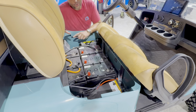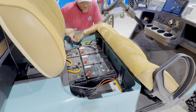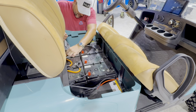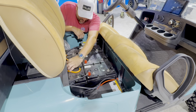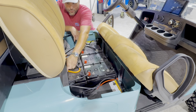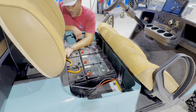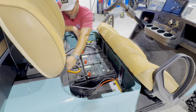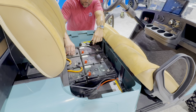We hit a little snag. There's a rear cover here that covers the golf cart's rear body and the battery is tucked way back in there. So we're going to take a little detour with a 13-millimeter wrench. Loosen the nuts on the top of the batteries very carefully — be careful not to touch your wrench to another terminal. Put the wrench on the nut, loosen it a turn or two, and then you can loosen the nut the rest of the way by hand.